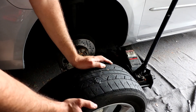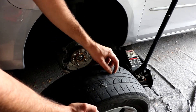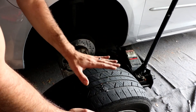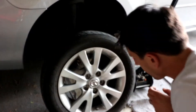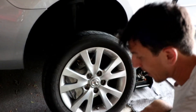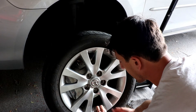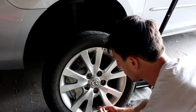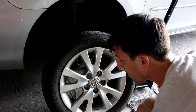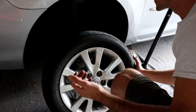You do want this to dry before you pump up the tire. I'm going to go ahead and put the tire back on while this is drying. You might want to let it dry before you pump it up and double check it for air before going further. You need to put the valve stem back in the tire — just slide it in and use the valve stem tool to go clockwise to tighten. You don't want to tighten it too hard — just a little, maybe not even a quarter turn. Before pumping air, I want that to dry fully, but in the meantime I can put the tire back on the car.